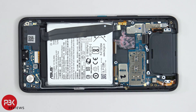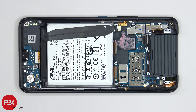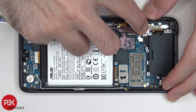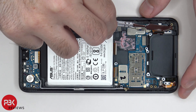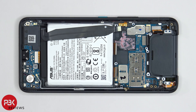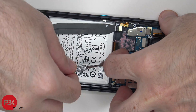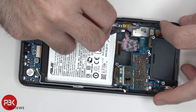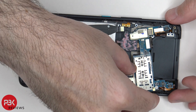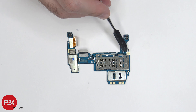Back to the rest of the phone — we have more flex cables to disconnect. There's a metal bracket or cover over here on top of the connectors which needs to be removed. We need to slide it out to remove it. These two flex cables are just extensions which connect this bottom board piece to the main board on top. Now we can go ahead and pry this bottom board off. The SIM reader and memory card reader is located over here. There is yet another liquid damage indicator located over here in the corner.